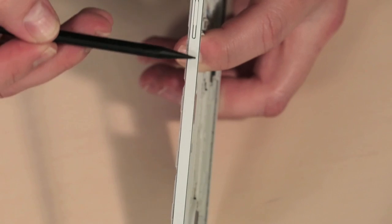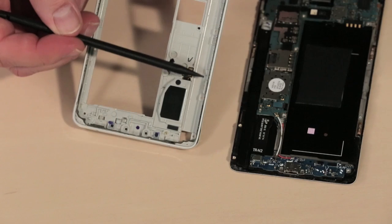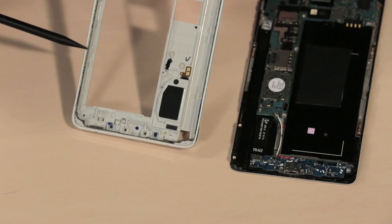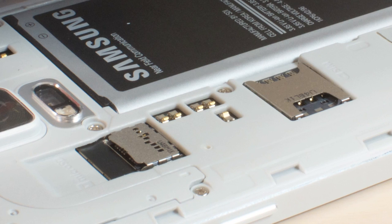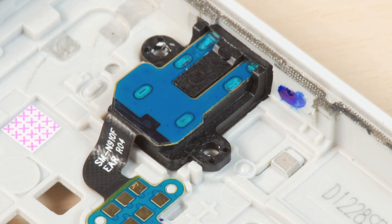As I mentioned at the beginning of the show, the Galaxy Note 4's design isn't radically different from that of the previous model, but Samsung did make several subtle design changes and one big one. The major change is to the front panel and frame assembly. The phone's metal rim is part of the internal cover instead of the frame, as it was on the Note 3. There's also a thin adhesive seal between the front panel and the internal cover, which wasn't present in the older model. This design element makes the device just a tad bit harder to crack open and reassemble than previous Notes. The smaller changes include things like a redesigned circuit board, repositioned SIM and microSD card slots, and a headphone jack that's attached to the internal cover, not the front panel and frame assembly.